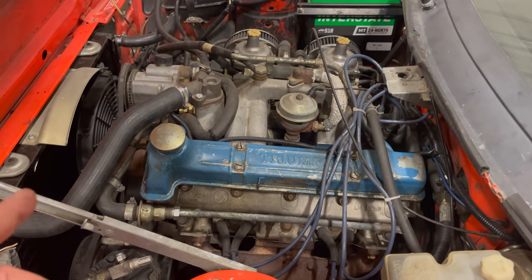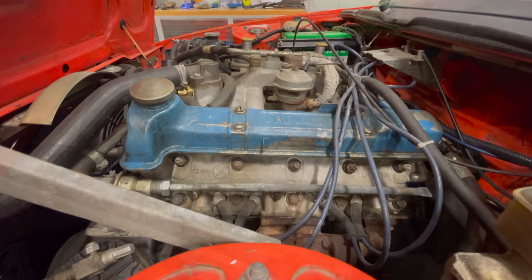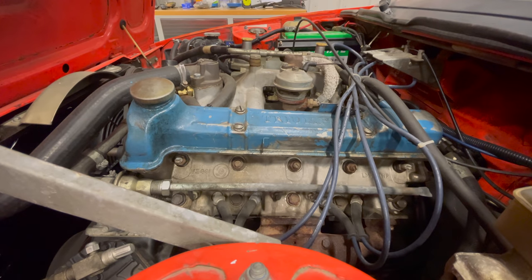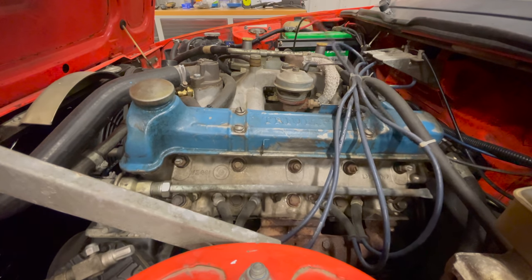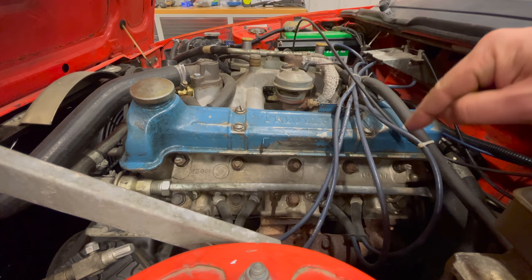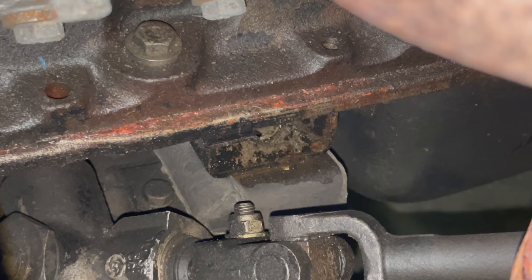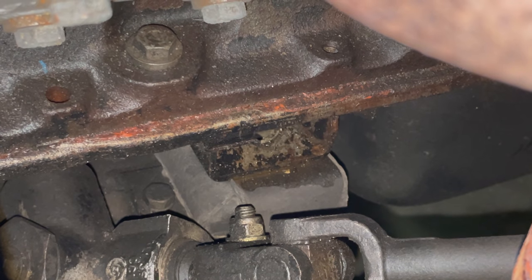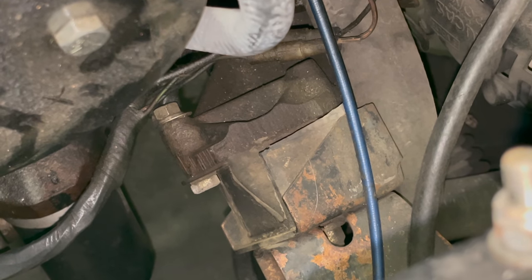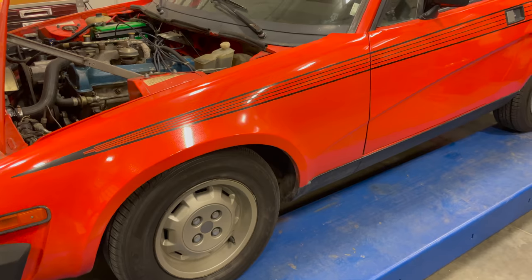But today I have a much simpler task to deal with. Let's start the engine up and I'll show you what I'm talking about. Did you see how much the engine was shaking there? I think the mounts have either gone bad, collapsed, or broken. This is on the left side of the car. You can see the mount down there — it looks like it might be a little bit squashed. And here on the right side of the car, it looks like the mount might be a little bit twisted. There is also a transmission mount underneath the car, and that's where I'm going to start first.